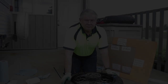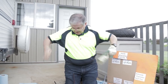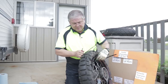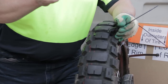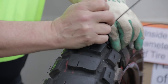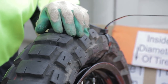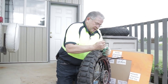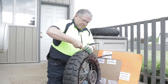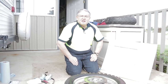I've also used this technique on other tires using the zip tie method, the bead buddy, and short tire irons. You don't need something big — you just need technique. On these Moto Zips, if you carry spares you can just cut them off — snip the zip and pull it out. But I've reused these same Moto Zips on a number of tires by taking a screwdriver blade — or in this case the bottle opener on my Swiss Army knife — getting it between the jaw and prying it open so I can reuse it on the trail. Carrying about four with you on the trail should be enough. One cautionary note: if you use the sharp blade of a knife, you might cut yourself. This is David with Best Rest Products — thanks, we'll see you on the trail.